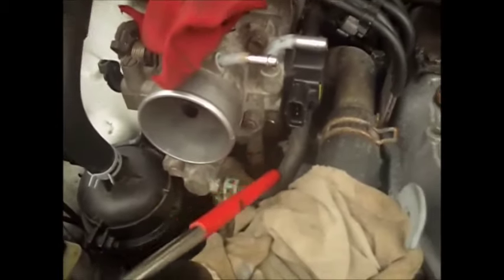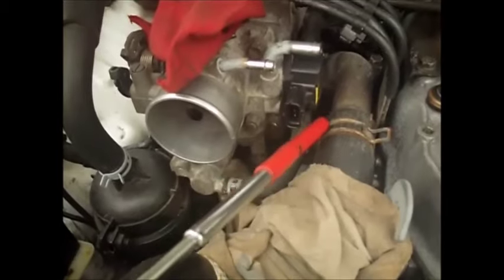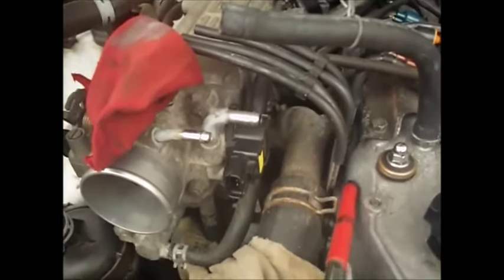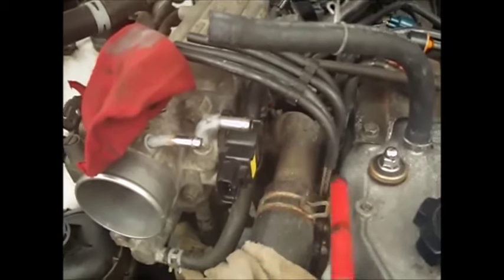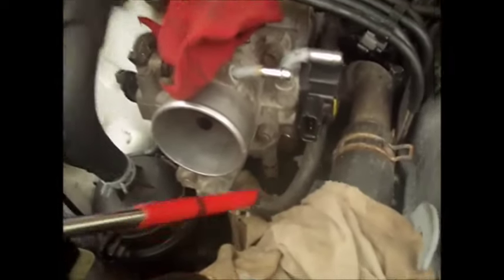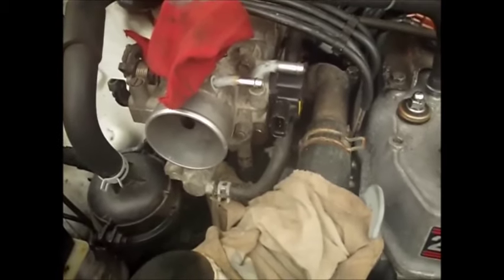And the last time I had this apart, I ran flexible wiring through here, completely through from here into the engine block, and released anything that was in there. And I did the same thing with these, which go down to the bottom of the engine block, and I couldn't find anything restricting the flow in there.